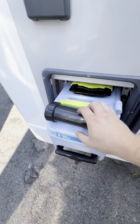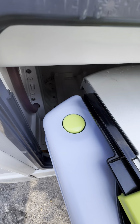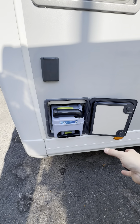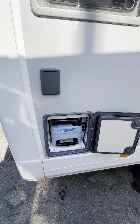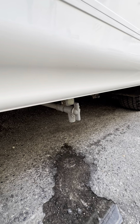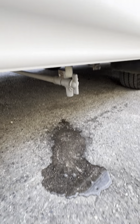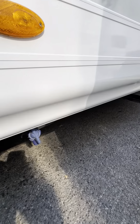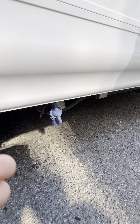All you need to know from there is that you drain it out from here. Whilst you're draining it out, hold down this little button here — that's a pressure release valve and it will allow everything inside to drain out nice and easily. Down underneath here on the rear offside, we've got your external wastewater drain off point — it's open at the moment which is why it's draining slowly. A little further up we've got your freshwater drain off point, the blue one, which works in exactly the same way as the waste.